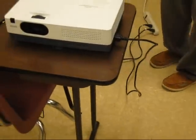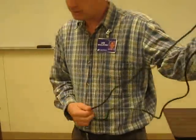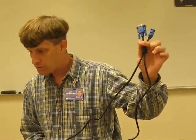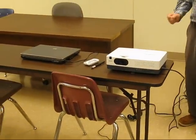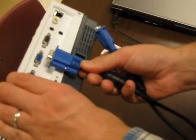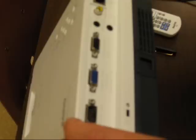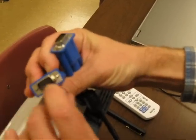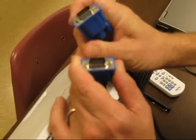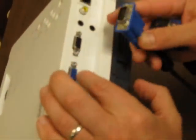Next, we're going to get the cord. This is the cord that's traditionally a monitor cord. What's going to happen is the projector will function as a monitor for the computer by projecting it on the wall. It's color coded — they're both blue — and it says 'Computer In' on one end. If you notice, the shapes are a little different: on this one, the bottom is bigger. If I flip it over, the top will be bigger. Make sure when you line them up that they're in the correct position.